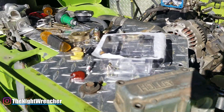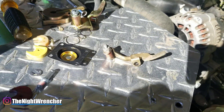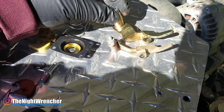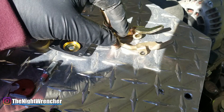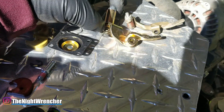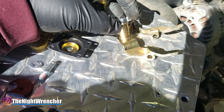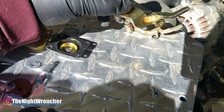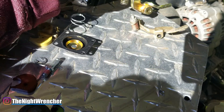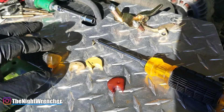I've got it all apart now. The first thing I want to show you is the difference between the 30cc arm and the 50cc arm. You can immediately tell there's a huge difference in both the geometry and the physical size. The steel for the 50cc arm is probably twice as thick as the 30cc one. The reason for that is there's more fuel inside, so there's going to be more hydraulic pressure it has to compensate for. Also, because of the way the cam is situated on the arm, it's going to be subject to a lot more pressure front and back, so you need more resistance to bending.